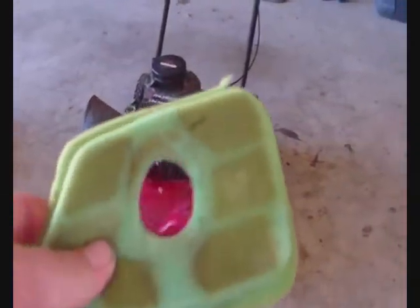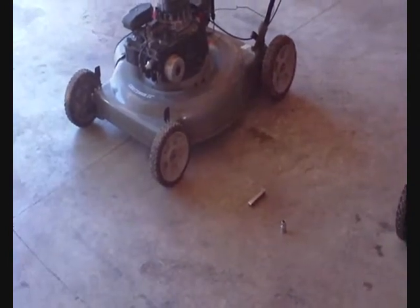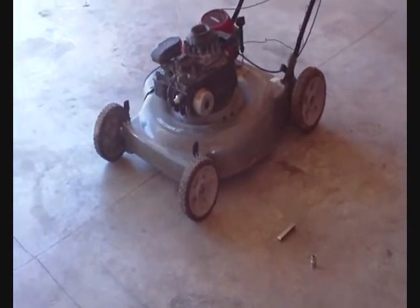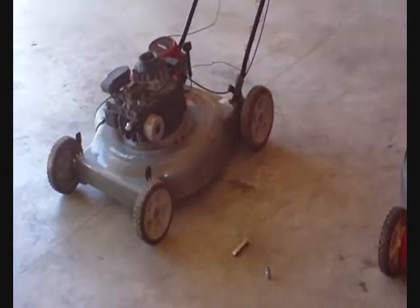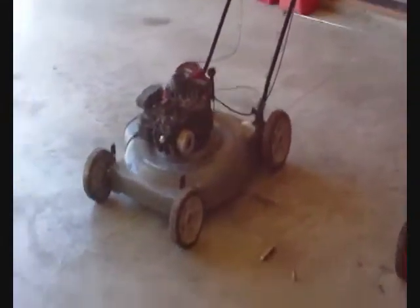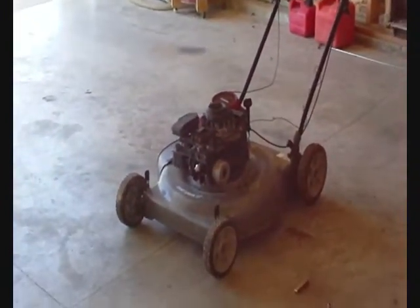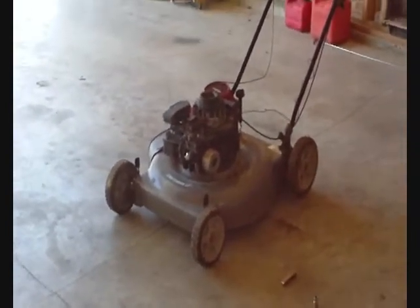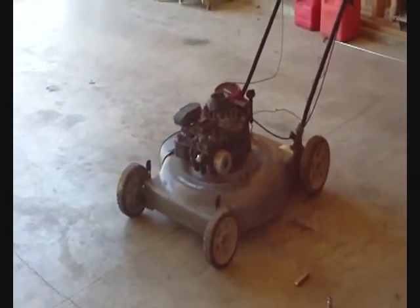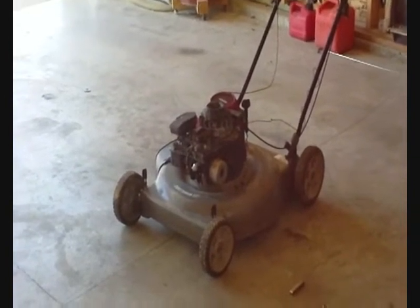While this is drying, I'll go ahead and start working on that one. All I do is pull the blade off of it and just fire it up, and if it doesn't shimmy or shake or anything, the crank's not bent. But if it vibrates really bad, then the crank's been bent and I'm out of luck. We'll just see what happens — I'm hoping for the best. I don't think it bent the crank; usually it'll shear that pin first, but you never know.